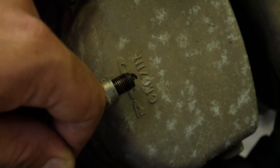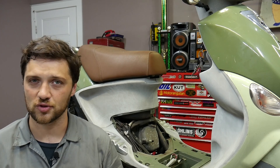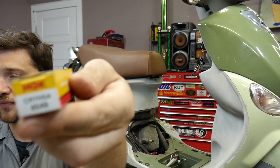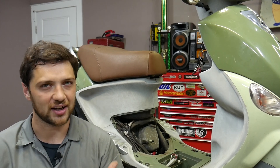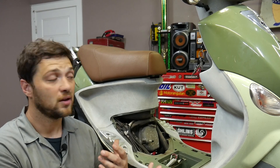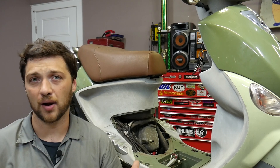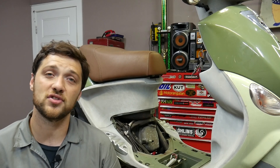This is a great example of good spark. If your spark is weak or inconsistent, the first thing you should try is replacing your spark plug. The only spark plug I can recommend for the GY6 platform is the NGK CR7 HSA — and I'm not sponsored by NGK or any company; this is purely from experience working as a professional motorcycle technician. If your spark plug is not sparking at all, you have an ignition system issue that you need to troubleshoot before going any further. Keep in mind a scooter can have multiple or compounding issues — maybe it was parked because of an ignition system issue and then sat so long the carburetor clogged. For more information on your scooter's ignition system, check out my video.